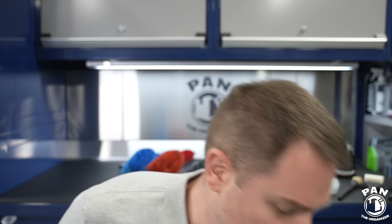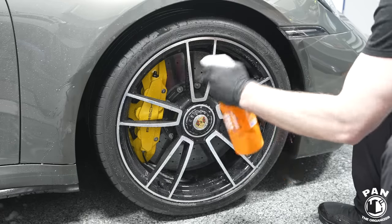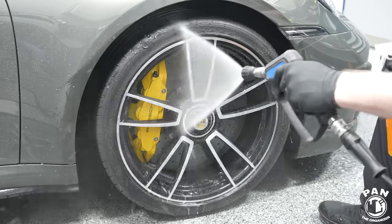A quick tip to improve the performance of your wheel cleaning routine for future maintenance washes — making those cleanings a lot easier — is to apply some sort of silica spray sealant. You can apply a full ceramic coating onto your wheels, which is the best option lasting 6 to 12 months, but that requires a wheels-off detailing so you can access the inner barrels to coat those. Wheel coatings also have higher temperature resistance for the braking zone. But if you don't want to remove your wheels or want something super quick, silica spray sealants with spray-on and rinse-off formulas are the answer. When you're done washing your wheels and they're still wet, you spray on a few sprays and immediately rinse off with your pressure washer or garden hose. That's it — you've added ceramic protection that will last two to three months in real-world durability tests.